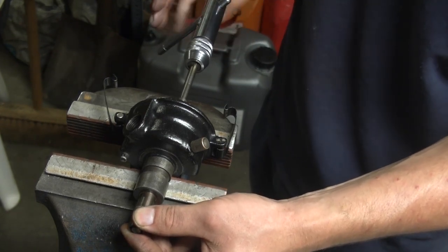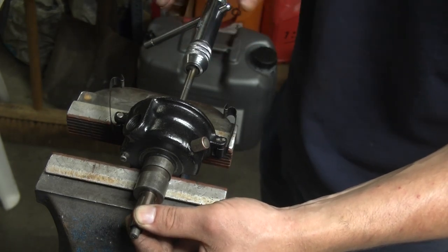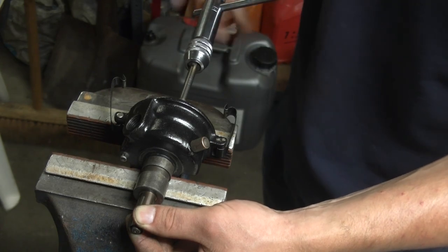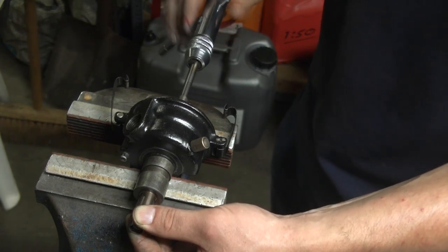No rush, unless you have a reamer that is specifically set to these. In these final stages, I do not adjust the reamer anymore. I just do it with another pass. That's going to remove some material again until it is enough. Because if I now adjust the reamer, likely I'm going to overshoot it.